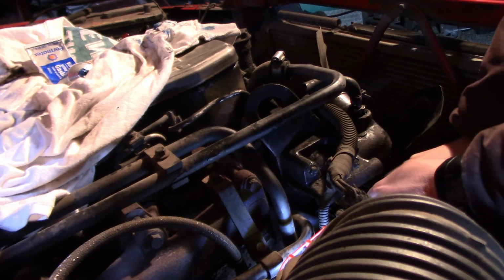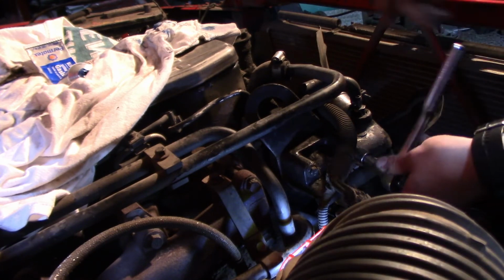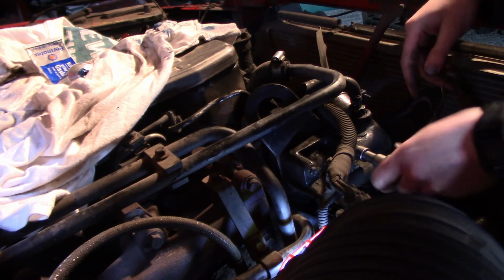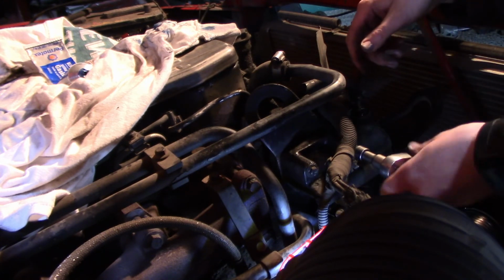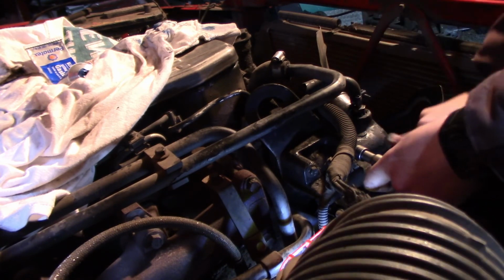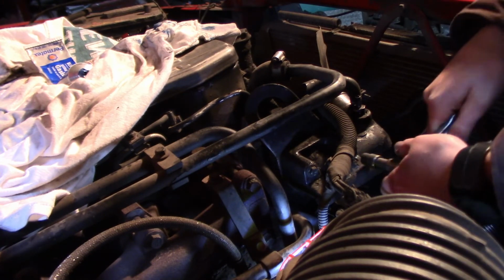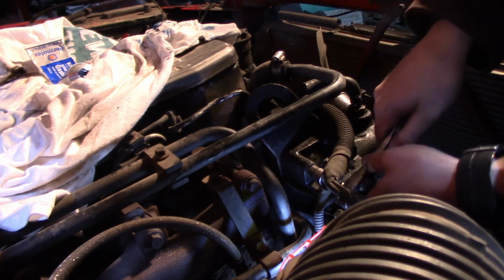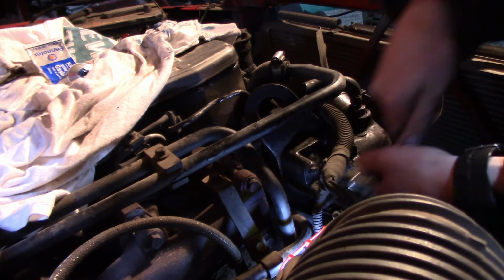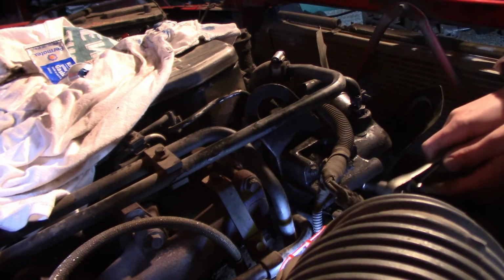We've also got what we believe to be a leak in the fuel line somewhere because we're having a hard time starting it. So the sputtering and lack of ignition we believe is air in the fuel line, so we've got to check that out. We actually repaired the leak in the fuel line last winter, so hopefully it's not the same thing, but this is an old gal, so you never know what's going on, so we got to check that out. It's always something.